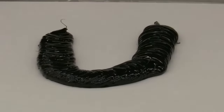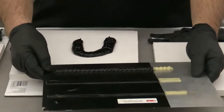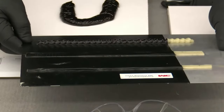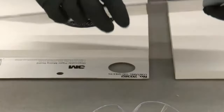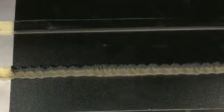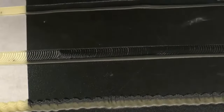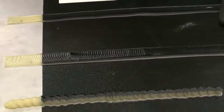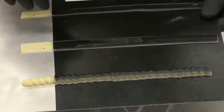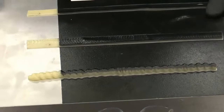And really what I'm talking about is when they paint the panel, okay, and you come back out of paint, it looks like we've got good coverage, right? We've got it in and around the seam sealer. But what happens in many cases, and again, it's not intentional, it's just kind of by default. I will give the painters a break here. They can't always get in and paint every area. And as a body man myself, there's nothing better than picking on painters. But in this case here, a lot of times they can't get into some of these tight areas and make sure that all that bare metal is covered.